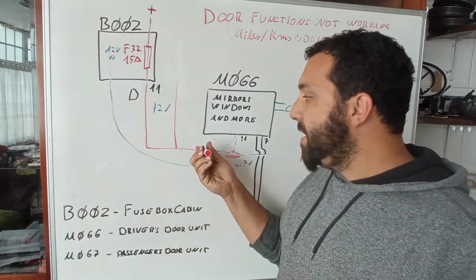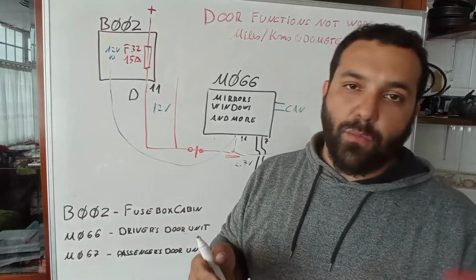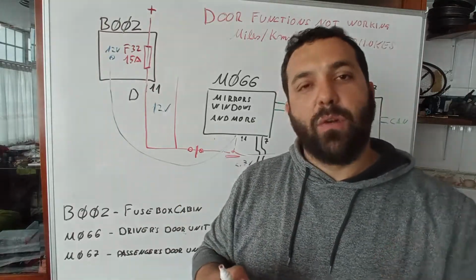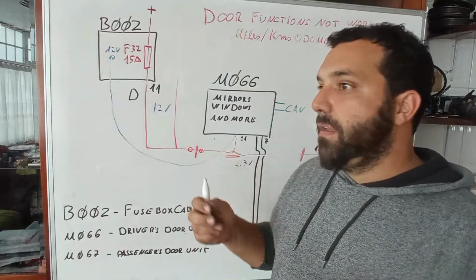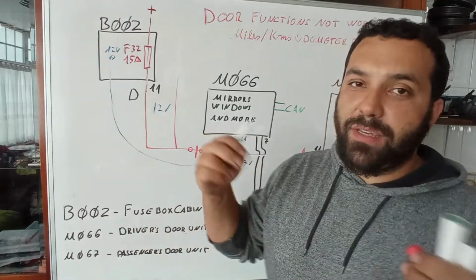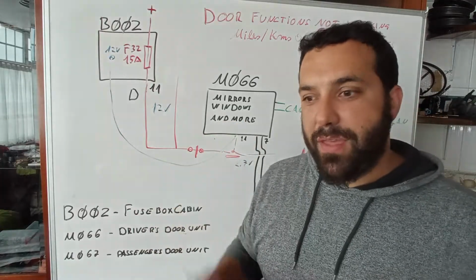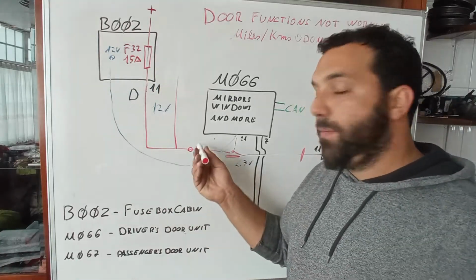And right behind the plug, on both sides, you can have problems, because on one side the wiring is constantly moving and it can break, and on the other side, for example, there is contamination with water, because these cars do leak water because of the inner sheet metal of the doors, like I told you, okay? And you can have problems over here.